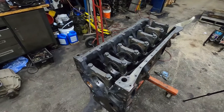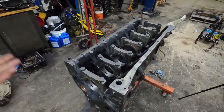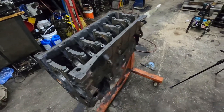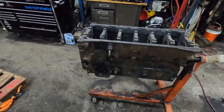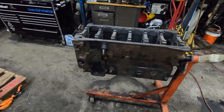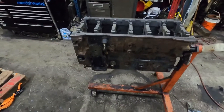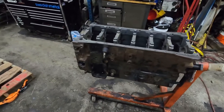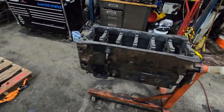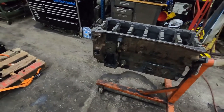I didn't have time to wash the block today, so this is one I already had ready to go. We're going to use this block to finish off — like I said, it's the same block, I just didn't have time to clean it and get it back in the jet wash. For simplicity's sake we'll use this block and not have to wait a day. I'm going to put it on time lapse, pull the main caps off, put the bearings in, and then I'll come back and we'll check a few main bearings to see what their oil clearance is going to be.